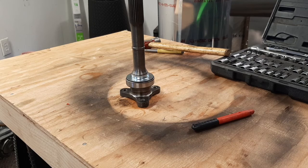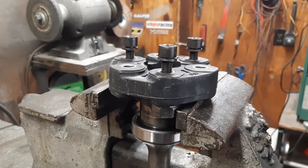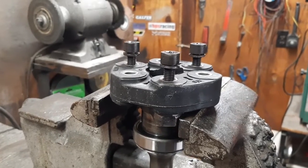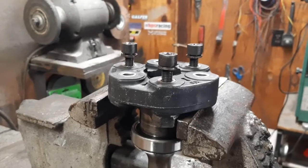But I do want to make sure when it's all bolted together that it can't come loose, because you don't want that rattling around in there. But I think it should be sandwiched behind the slave cylinder. The instructions with the couplers say if there are any arrows or markings on which side of the coupler should go which way, to follow those. If there aren't any arrows, it can go either way. Okay, so it doesn't matter which way it goes.